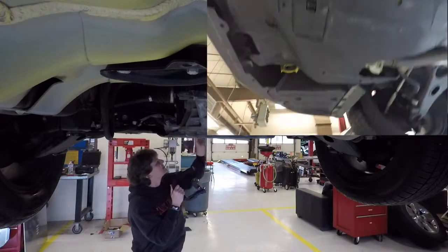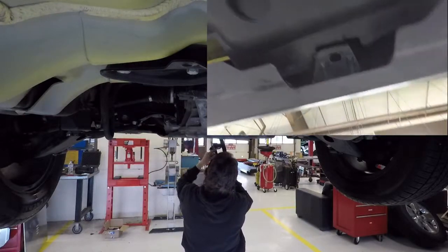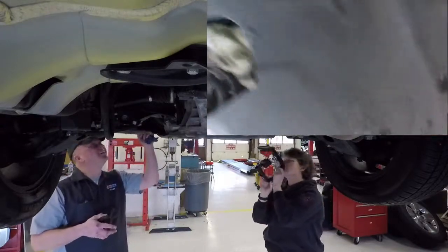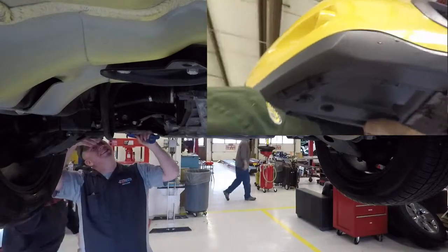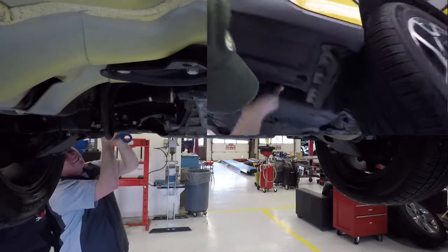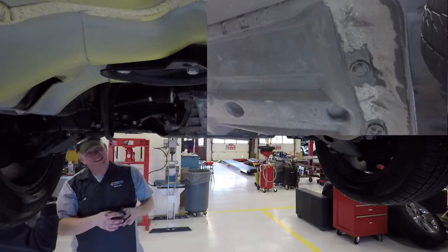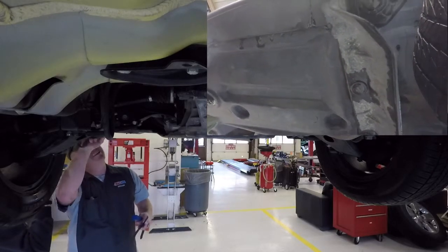So before you can actually install the front body armor, you have to remove this underskirting on the Subaru, which most Subarus have if it's not been destroyed or removed by previous work. It's a bunch of body clips, the little plugs, pretty easy to remove. There's a couple bolts that you pull out, and once it's out of the way, it exposes all the bolt holes that you'll need to use to mount the body armor. A couple of the plug bolts, I put the body plugs back in and let those fill the holes, so they don't get lost.